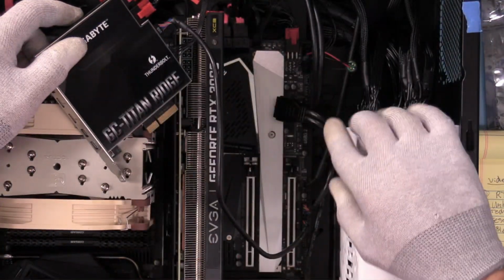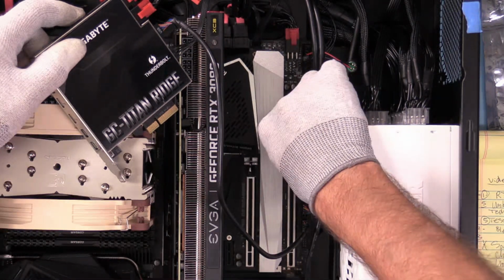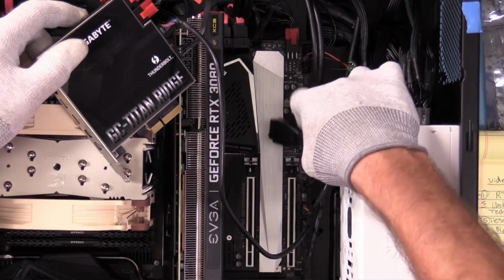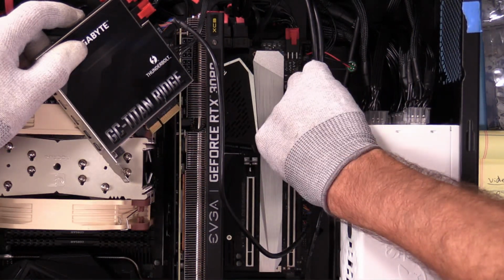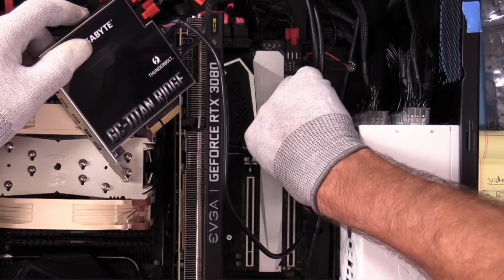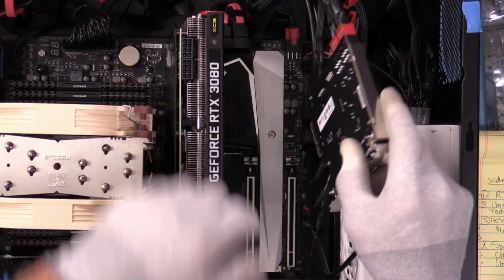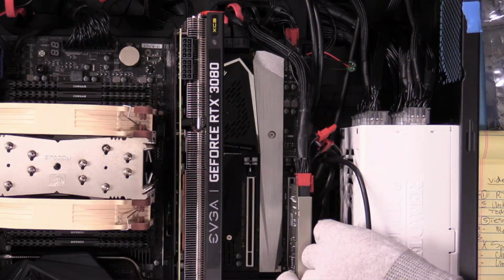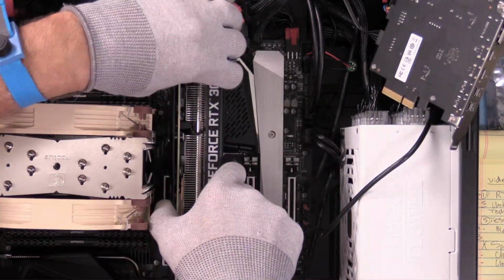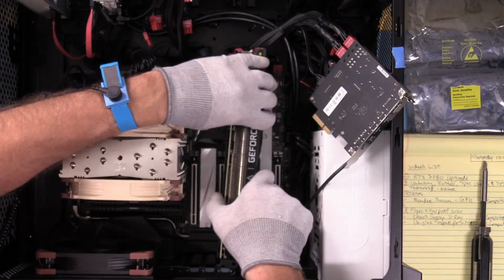Wow. We originally had to disconnect the USB connector to the front of the case because there wasn't enough room with the Glowtrends Sky card to have that connected. This connector is just too fat. So I'm going to put it back on. And since we're going to lose that last 8-lane slot, let's see what the BIOS does, because the BIOS is set to initialize the first slot, and we're going to be putting the video card down in this second slot, and then we're going to see if we can put Thunderbolt 3 in there. So I'll set Thunderbolt aside for the moment. Let's pull the video card, and we're going into two positions. So I have a bracket here in the back I need to pull out.